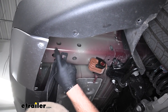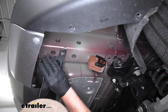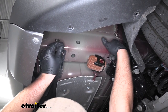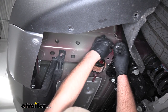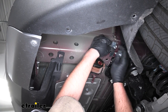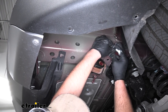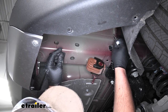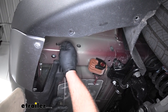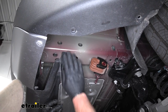To get our hardware in place, we're going to use a fish wire, using the two holes as attachment points. Starting with the hole closest to the back of the vehicle, take the coiled end of the fish wire and push it toward the access hole we enlarged, getting that coiled end to come out. Once you have it out, take your spacer block, slide it over, then thread the carriage bolt on. Feed the hardware inside the frame rail, pull on the other end of the wire to make sure it comes out freely, then barely set it back inside the frame so it doesn't interfere with the hitch when we go to put it up.